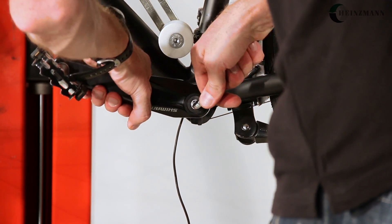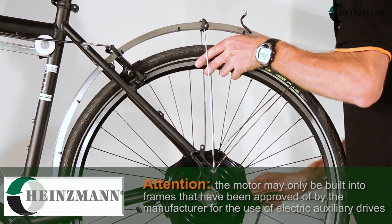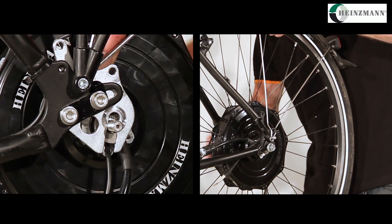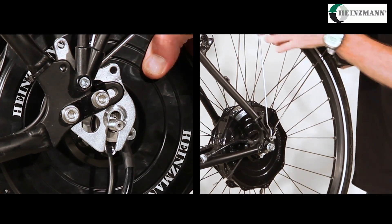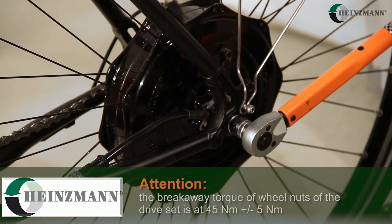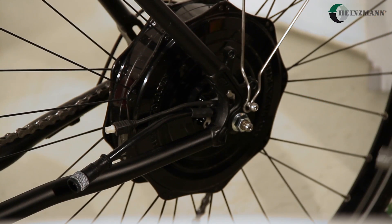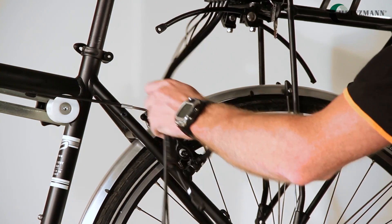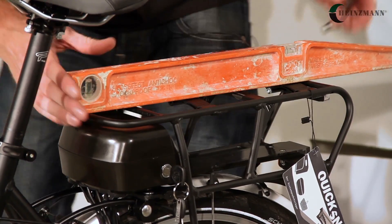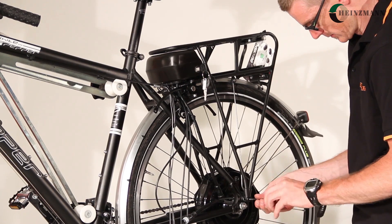Torque down the crank arms on the axis, and again pay attention to torque specifications by the manufacturer. Carefully put the wheel into the chainstay — the cables should run the same way they shall be fixed to the frame later on. The dropout has to be sufficiently long for a safe installation of the motor; only this guarantees reliable fixing of the motor axis and the torque arm. To fix the pre-assembled carrier to the chainstay, adjust it with a water level and tighten the screws that were part of the set.